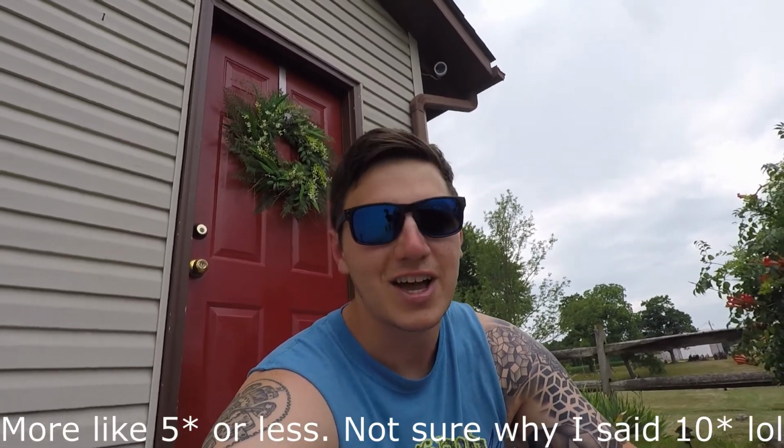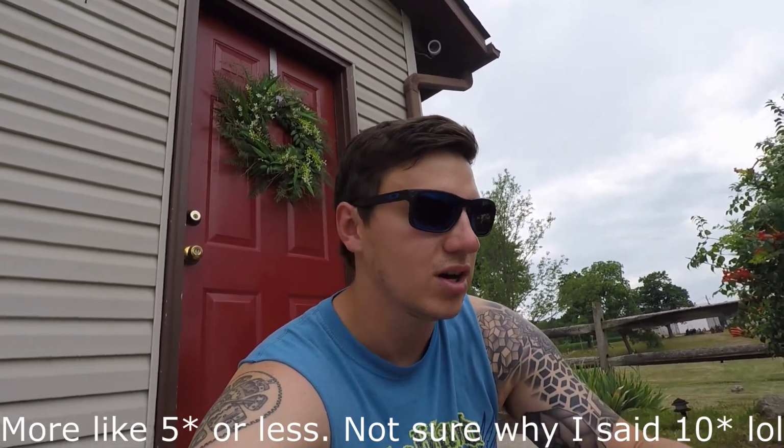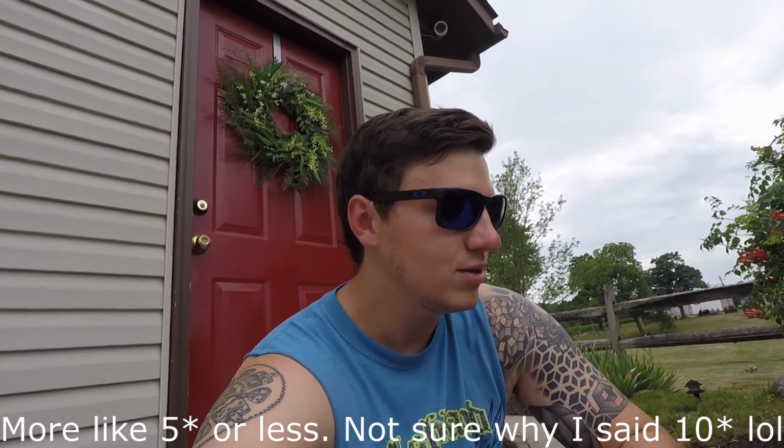And yeah, so the big difference afterwards was, on a stage one tune with the stock intercooler, I was seeing over 30 degrees higher above exterior or outside temperatures on a pretty prolonged pull. And it's hot right now, too, so it's 90-plus most days here and super humid. With the V3 on a stage two from Dizzy, I'm seeing less than 10 degrees higher on a prolonged, multi-gear pull. So totally worth it in that regard.